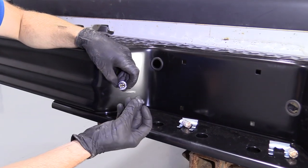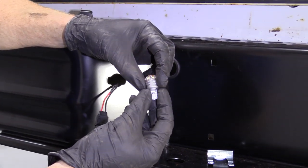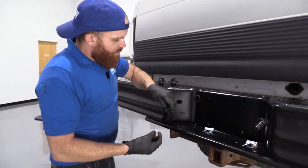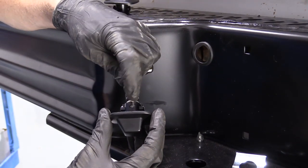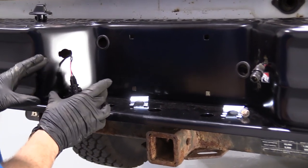So now you're going to want to put some bulbs in these. Generally speaking, you'd use something like this — this is a 194, and they are breakable. What we chose to go with is an LED 194; they make these in all shapes and sizes. We went with the biggest we could because we love this truck — and we're going with the LED tail lamps too, so we might as well go LED here. Pop it right in there, give it a little wiggle — that feels great. You've got a little nub there and a little slot there, just press it in with a little twist so that it's locked in. We'll do the same to the other side.